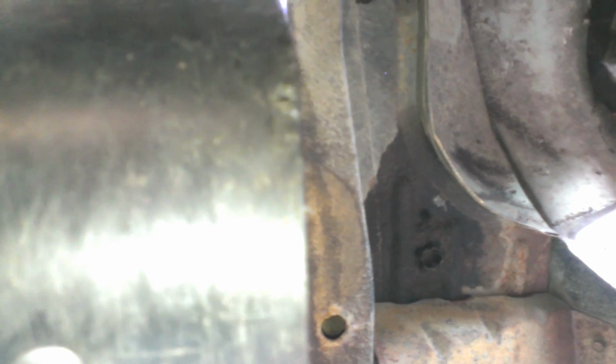Before you put those hoses on though, make sure you get your evap lines on. The evap lines stretch far enough that you can pop them on before you really get to do anything. I think that's on there. Yeah, that's on there. And the same with this evap hose up here. That one you might be able to get to from up here actually. That's not too bad. But yeah, do the evap hoses first, and then do your rubber hose, your main fill and vent lines.